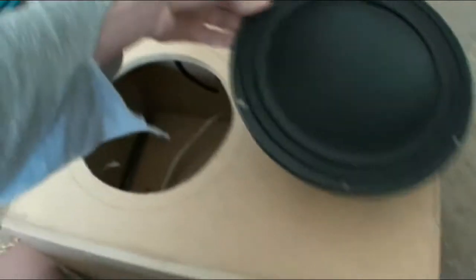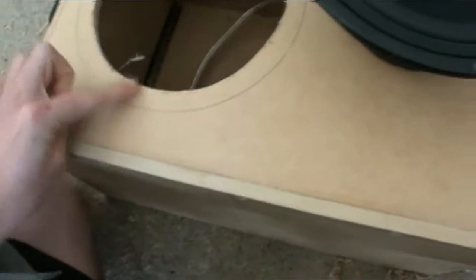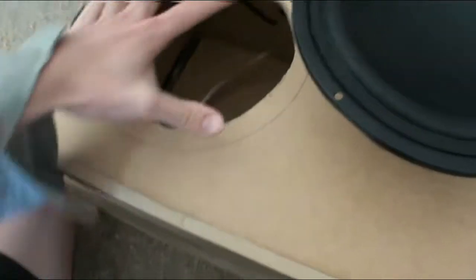Here's one sub in — not screwed in, but in. I'll pull it out for a sec. So there's the hole. All I do is trace it around the outside, then measure how far it is from the outside to the woofer, draw that, cut it out — it's too easy. These didn't come with a template, though I think some do. That's okay, that's how I do it. Still going to do the other one — the holes are ready for it over there. I've got it pre-wired from yesterday. It's all wired and set up. These will be set in series, so there'll be a four ohm load on the amp.